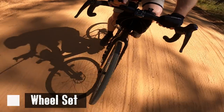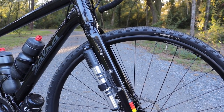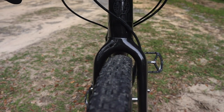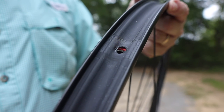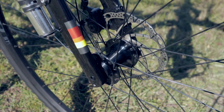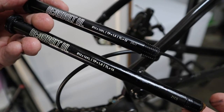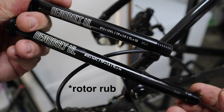The Salsa Journeyer comes with a great wheel set. My bike came with Teravail Washburn tires at 700C x 38mm, which I've found to be decent with good grip on hardpack, sand, and muddy conditions. I've since upgraded to Maxxis 700x50 tires for more traction on softer gravel — and Salsa says you can fit up to 2.4-inch tires in the 650B wheel configuration. The rims are WTB STI23 700C tubeless-ready with 23mm inner width, mounted on a WTB Serra 12x100mm front hub and WTB HD10 12x142mm rear hub. The 12mm through-axles keep the frame stiff for improved tracking and more consistent braking.